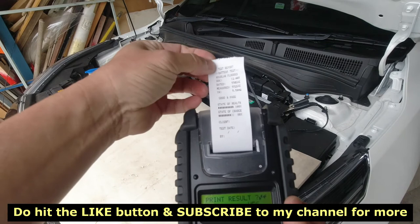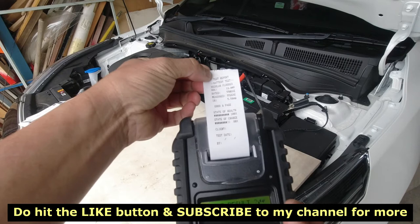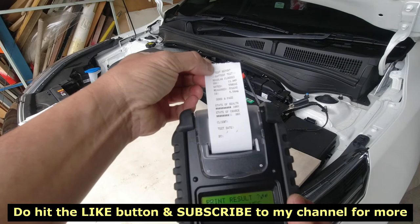It shows the state of charge, 12.44 volts. The rating, 550 SAE. What was measured was 552. Internal resistance, 5.58 milliohms. And the battery is good and passed. State of health 100%, state of charge 80%, and you can write the date and time this is tested.